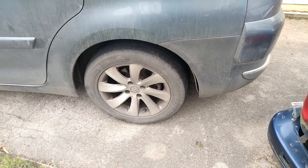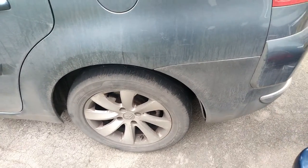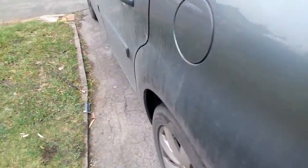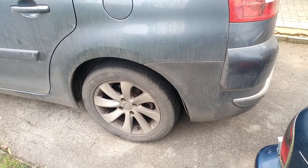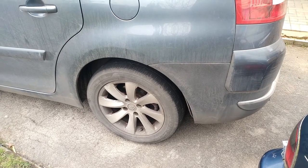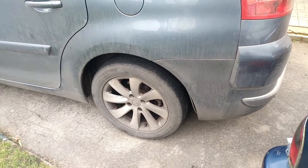And there we have this side done. Honestly, the longest part of it was jacking it up and taking the wheels off and putting them back on. Yeah, as you saw, once you've got it up in the air, it's nothing to take the air spring out. You know, just release the airline, it'll then just twist out, pop a new one in, and away you go. Definitely something you can all do at home.